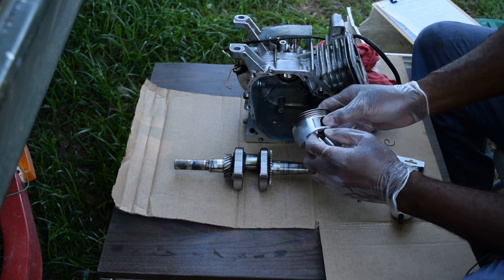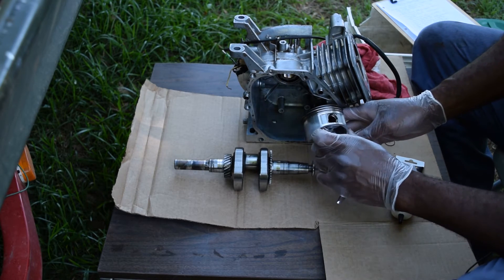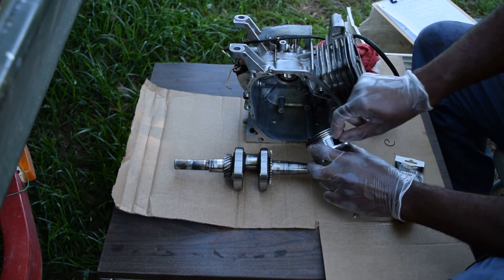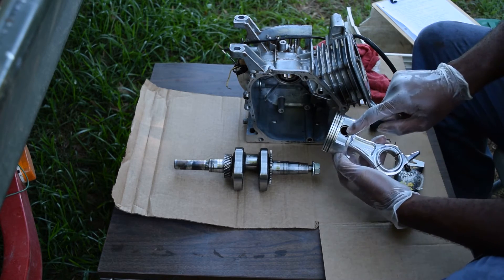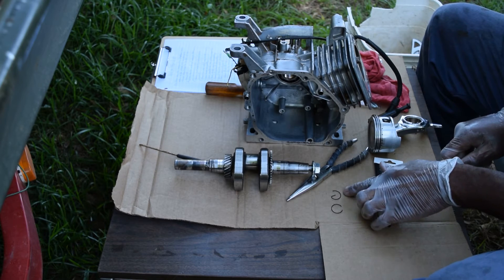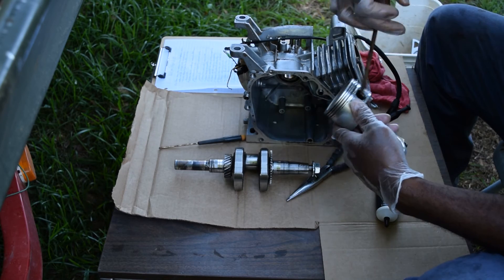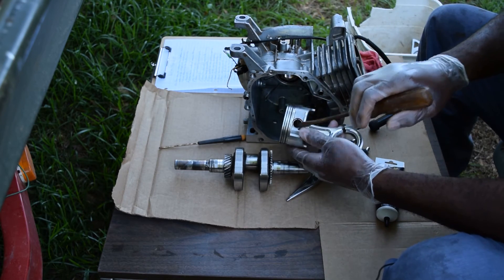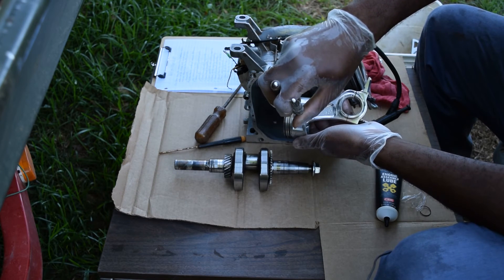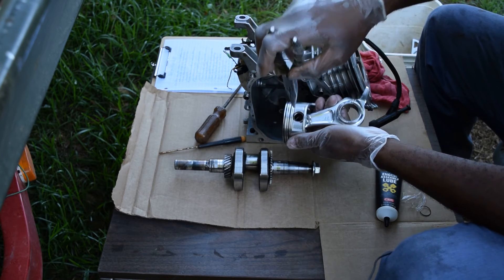That's already in there, the only thing we need to do is just make it click — did you hear that click? That's all you need to do. See, the original clip doesn't have that G shape, which makes it harder. So we're going to replace this other one as well — old clip, new clip. Just make sure it's seated all the way around. Instead of trying to get those needle nose into that little groove, you can come right to the middle of the wrist pin and pull it straight out — bam, it'll pull right out.